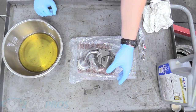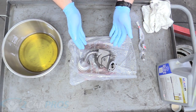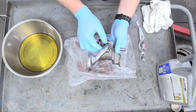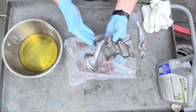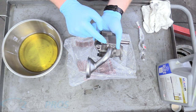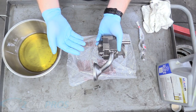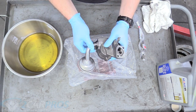Here is our oil pump we're going to be using today. It's Summit Racing's in-house brand — a high performance oil pump, pretty beefy style unit. One important thing to check on aftermarket units is that the oil pickup is actually welded into the body of the oil pump like this one is. Make sure there are no big gaping holes because you'd have leakage, you wouldn't get the right oil pressure, and you'd probably ruin your engine.